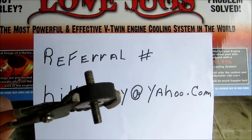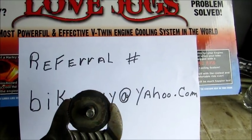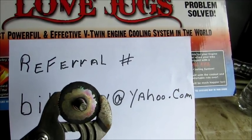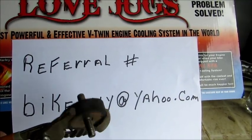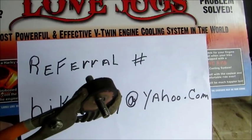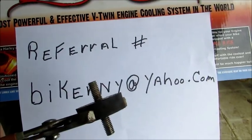That extra piece they added is actually wider than the original that came off my bike. The way I'm holding it — notice I've got the channel locks on the metal part, going through the rubber onto the metal. Do not line up your channel locks in the center of the rubber without grabbing that metal part, otherwise you'll shred the rubber. He said it's a nightmare to get off, so he stressed that and I'm stressing it.